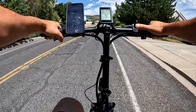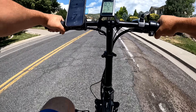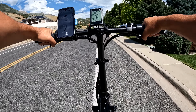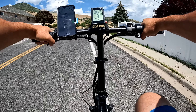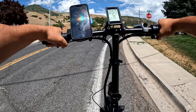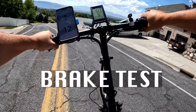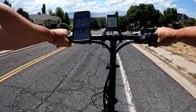There's no hill-ready rating for the NXB, but the motor does produce 62 newton meters of torque. With 58% battery on speed mode five, starting to climb right away on a 14% grade hill about two blocks long — I'm in seventh gear going 8 mph and the bike's doing about 90% of the work. As it gets steep, I lower to gear two — much more manageable. It's got better climbing power than I thought. Bouncing between 6–7 mph, I feel I need to contribute about 50%, but it could do it on its own, just slower.